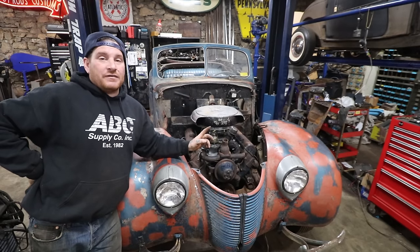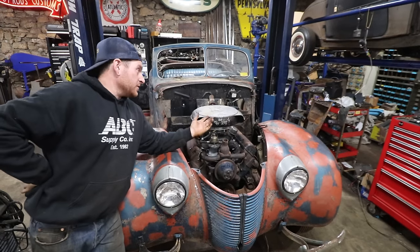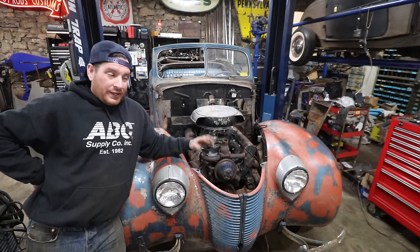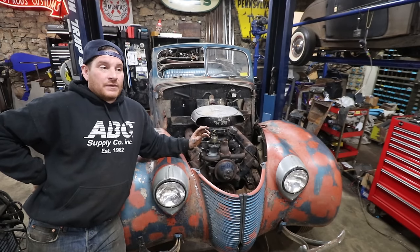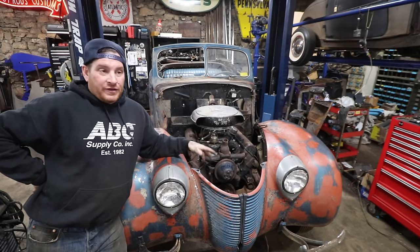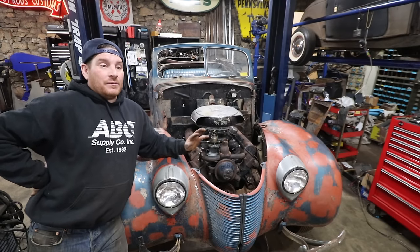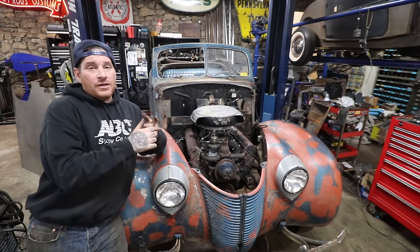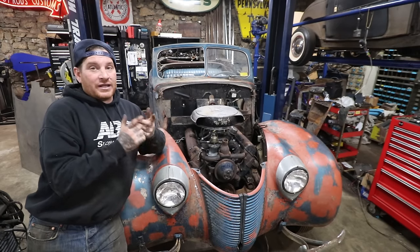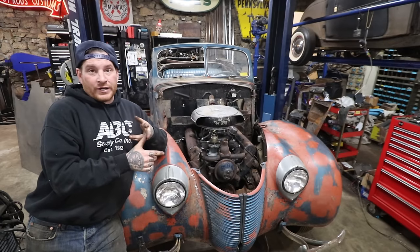So we do have an extra firewall that I think we can make work. So I think what I'm going to work on in one of the next videos is drilling all the spot welds out, taking the firewall out, putting a replacement firewall in, and then work on adjusting that firewall to fit around the engine and fit into the car correctly and doesn't look nearly as bad. Now by doing this, we can start hooking up original type of like 39 pedals that will get us hydraulic brakes. We'll attach to the trans, and all the pedal stuff will work out really nice.